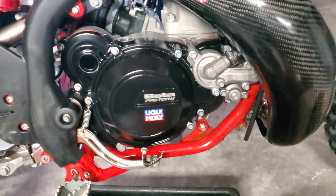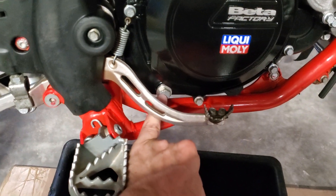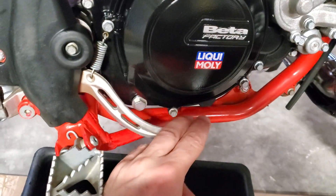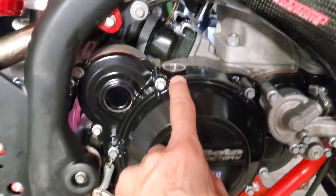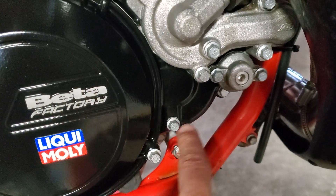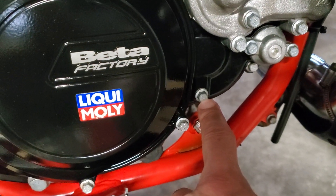This bike is a little bit of a pain — this is my first oil change. You've got to loosen this bolt which is behind the brake pedal here, which isn't too bad. You can just push the brake lever down — that's your drain plug. Then you've got your fill plug, which I already took out, right there on the ground, a little black thing. And then you've got your oil check plug — you can see it, it's on this rounded section here. Apparently you're supposed to fill it until that oozes out.